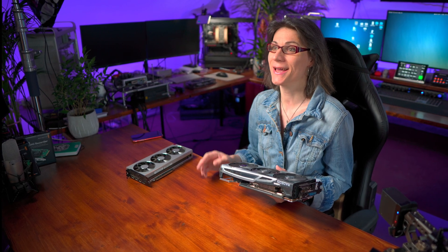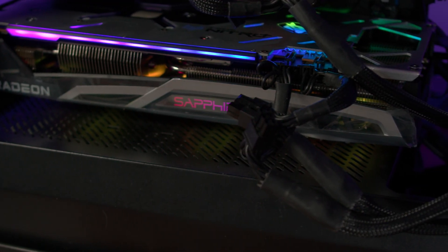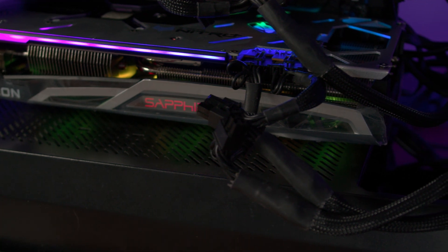During my tests, if I had it connected with both 8-pins on a single cable, it was shutting down my computer — despite having a very good 1200W Corsair PSU. Once I connected 2 separate 8-pin cables, all was fine. In the currently latest macOS Big Sur 11.4 Hackintosh, the fans start-stop feature is working perfectly. On idle or low load, the fans are completely off.